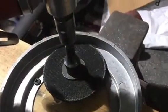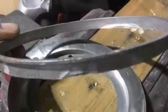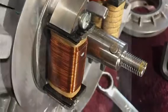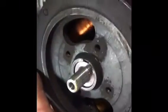The flywheel goes in behind, or underneath, which allows the taper to come all the way out and tighten up. Somehow this has to come off. Now you can see that the flywheel has gone all the way up on the PTO shaft, or the crankshaft, like it's supposed to. It's hard to see back here, but you can see there's a gap between that metal piece and the flywheel itself.